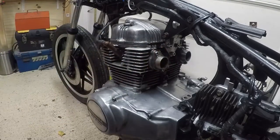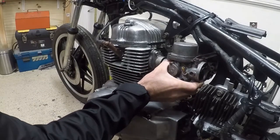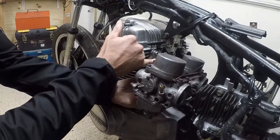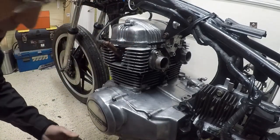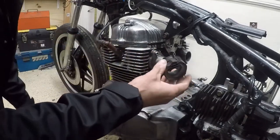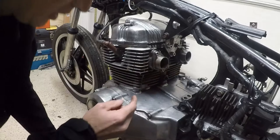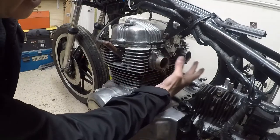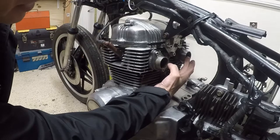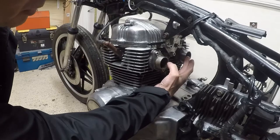So the carburetors clearly go into position in here, and the rubbers that go between the carb and the inlet, mine are knackered. They're like concrete, there's no flex in them and they're broken, so I need replacement rubbers. But when I was looking online, the rubbers seem to be about £50 for the set, and I may well still buy those in the future, but I want to know if it's going to run, and I think that's overkill for the purpose of my testing.